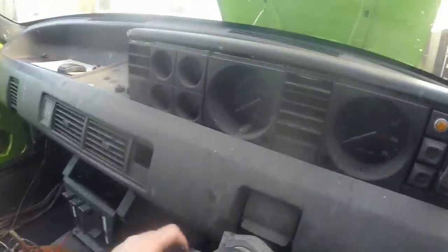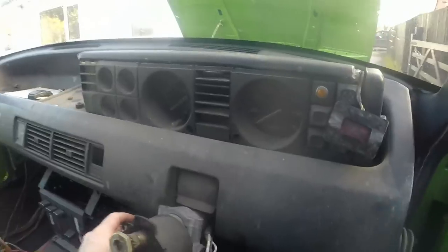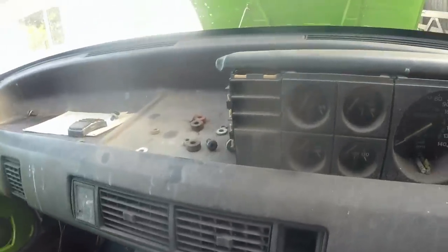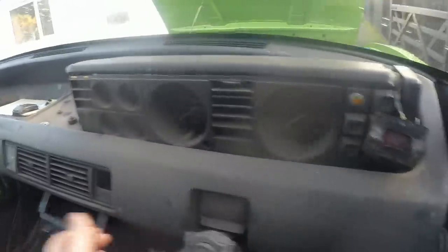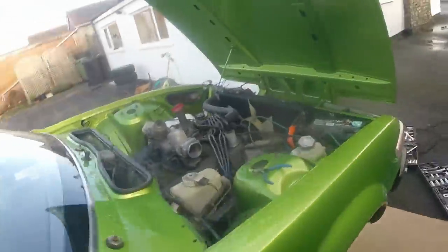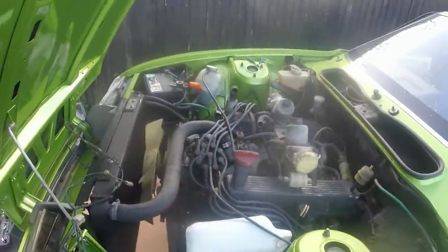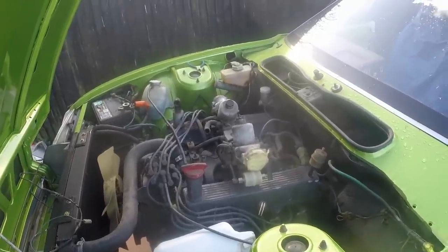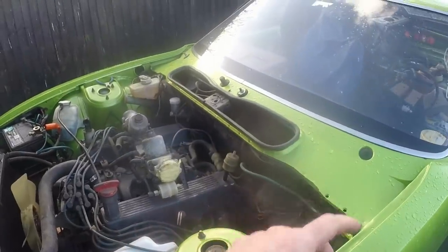Turning the key — I was turning it the wrong way. Ignition on, but I can't see any warning lights — there's a coolant warning level light though. I cranked it a few times and went to check the fuel: it's dry at the moment, so either it hasn't got sufficient oil pressure to switch the pump on, or that circuit isn't working. I never actually checked the pump wiring since it was previously running off a jerry can, so it could be a wiring issue or genuinely no oil pressure yet.